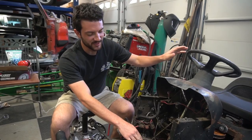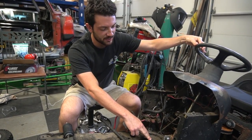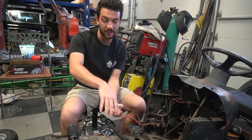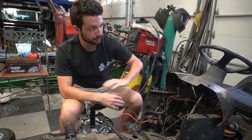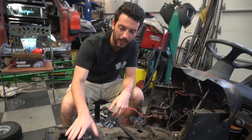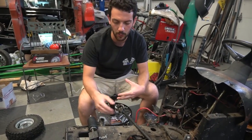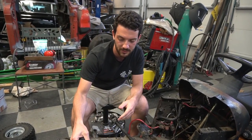So this is the factory steering, and we're replacing it because we have that much play in the steering wheel and no actual movement in the steering assembly, and that's just this piece. It doesn't include the play that could be in the underside of the steering. So we're completely replacing this with a Go Power Sports rack and pinion. It's not a kit, but it goes to a specific go-kart, though I'm sure you can adapt it. You can find a link to it in the description of this video.